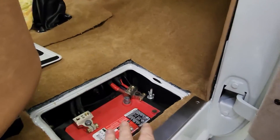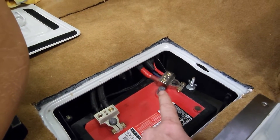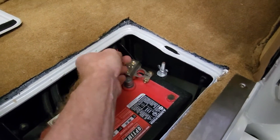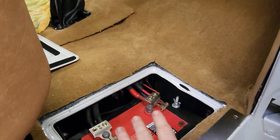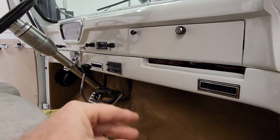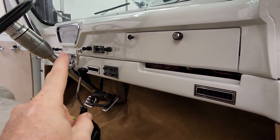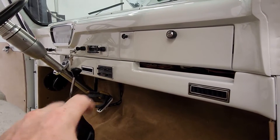On Deuce's 53 Ford, we have the battery in the stock location. When you install a fuel injection setup, they want these wires mounted in here permanently so it can feed the ECU 100%. When I was setting the truck up and finalizing things, I didn't want the ECU going hot so I just unplugged it. But when I went hot with it and keyed it over, we run, we learn, we do everything - we transfer data to the Dakota Digital from the Edelbrock so we can run the TAC, and then we run the fans on the relay circuit using the grounding from the ECU.